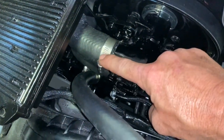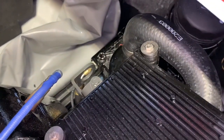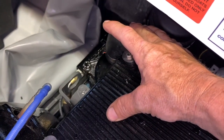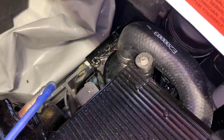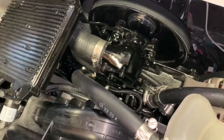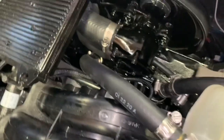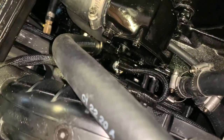You still want to come over here and remove this hose, look down, and get all the impeller pieces out — you'll probably want to clean the heat exchanger cap. If you have extra pieces from that bad impeller, they're going to be down in there, so pull off the heat exchanger cap and get the pieces out. If you can leave the pump in, it saves you time because you don't have to pull the belt. Just wiggle the impeller out, check down in there, see which way the keyway is, and line the impeller up to it.